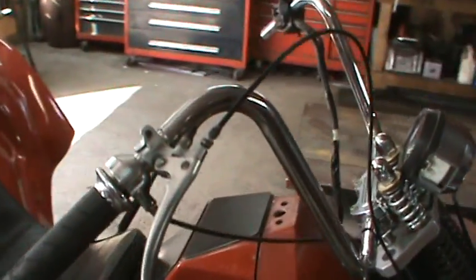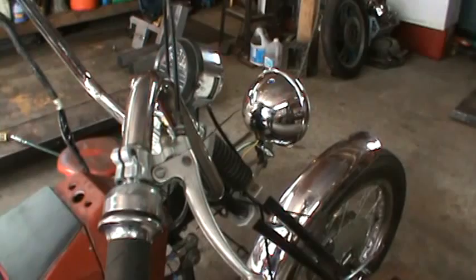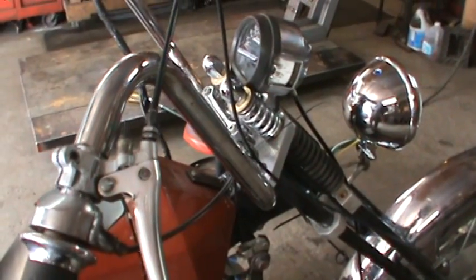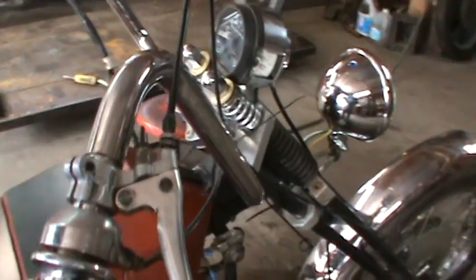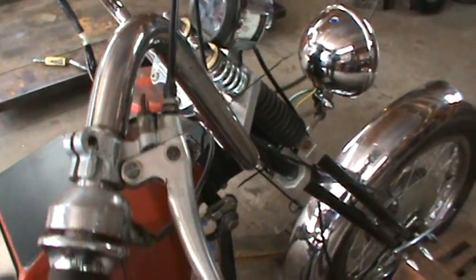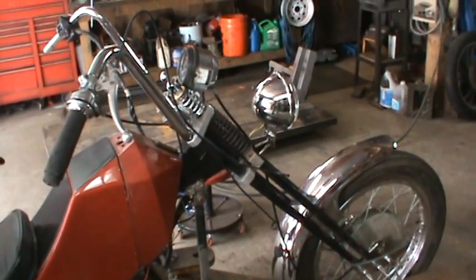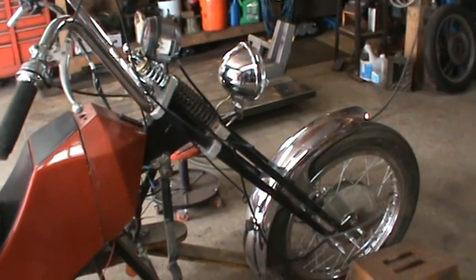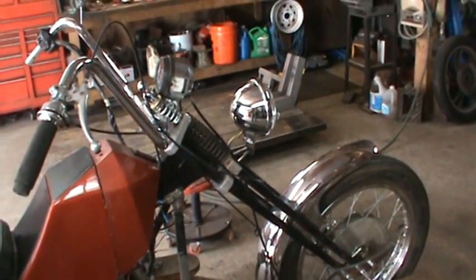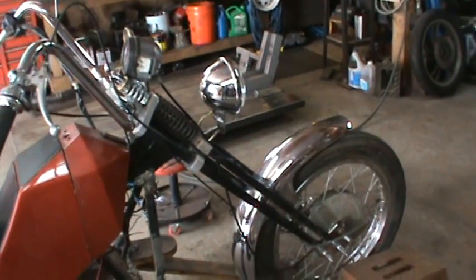And this is the brake lever that I got at one of my local motorcycle shops. It was a used one off a, I don't know what it's off of, probably some kind of Jap bike. But what I needed was something that had a brake light switch on it, and look at those two little tongs right there. That's what that does, so that when I hit the front brakes, my brake lights come on. So New Hampshire does have an inspection, and you must run a front brake, and it must also have a brake light on it, and speedometer and all the other pieces that go.